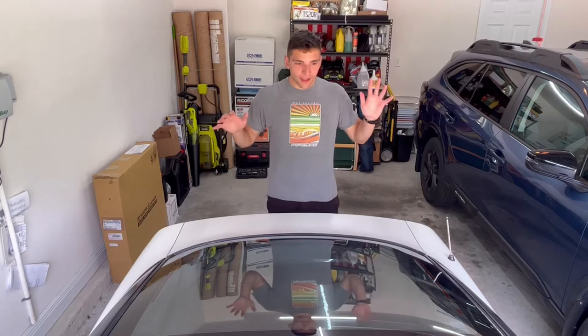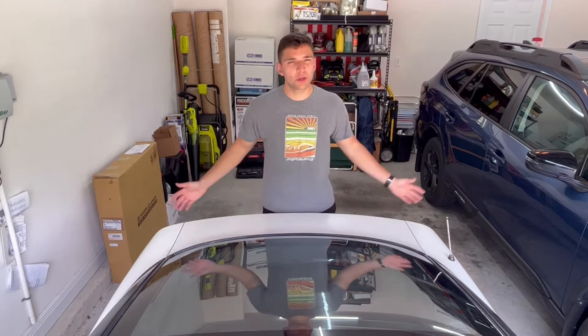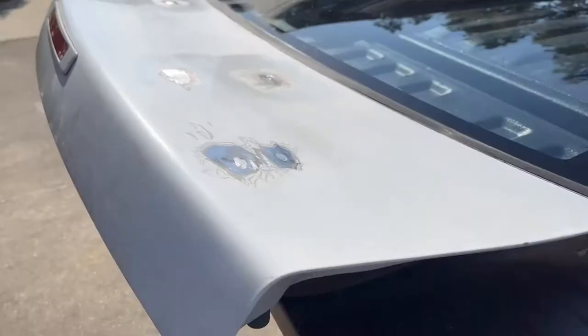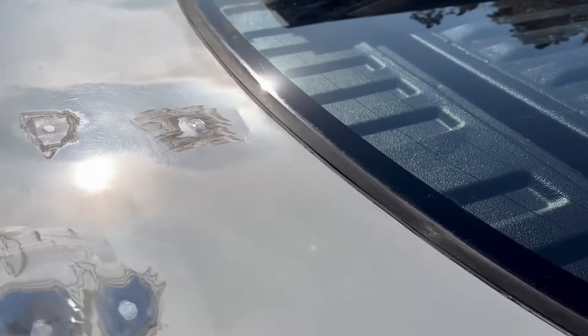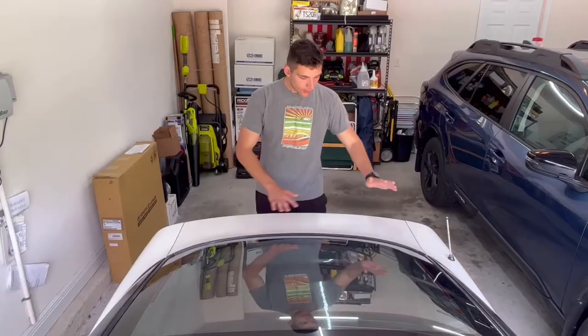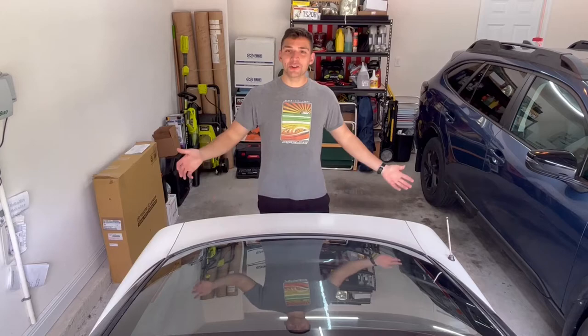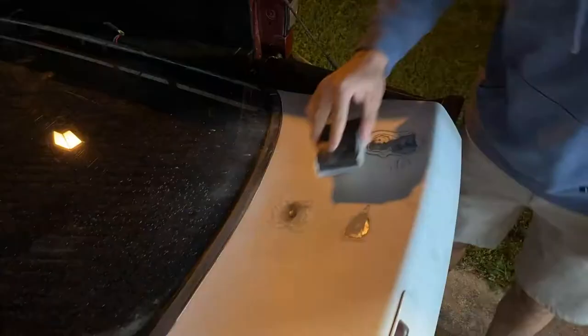Hey guys, I'm Sal. Thanks for checking out the video. Today we're going to be finishing up the hatchback series where I'm trying to bring this hatchback to life. It's my 1992 Nissan 240SX, and there were a bunch of holes drilled in this deck lid for a bunch of previous spoilers that have been mounted. We left off in the last video with me filling those holes with solder and leaving it with bare metal. So in this video, I went through and filled all that with Bondo, sanded it smooth, and then painted it with some OEM Nissan White using rattle cans, and it came out pretty good. Let me show you how I did it.